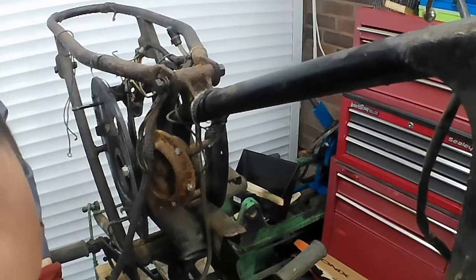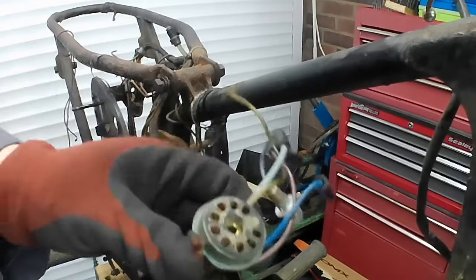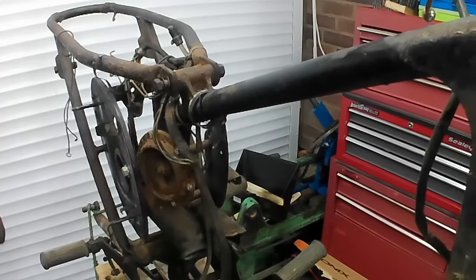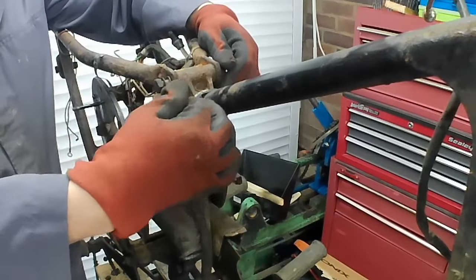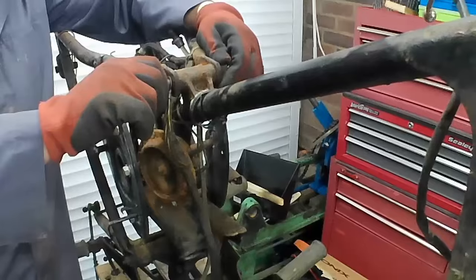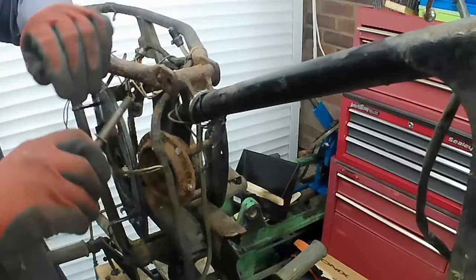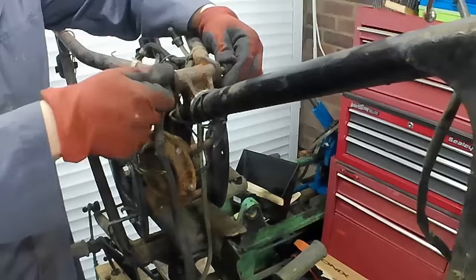So, where were we? We just liberated this lot from the headlamp. There's the sockets. And now we're along the top tube, and we found the earth bonding point, the main earth bonding point, with the transparent cables all massed together there on a ring terminal. This subframe bolt is already loose, because Peter would have undone it to remove the tank. So that's a simple matter of getting the terminal off, and we can just put that back in loosely.